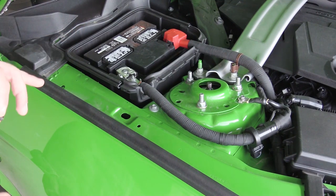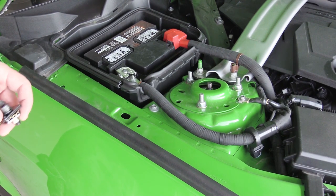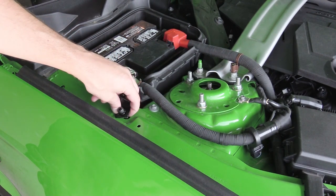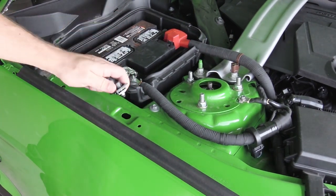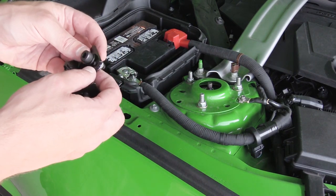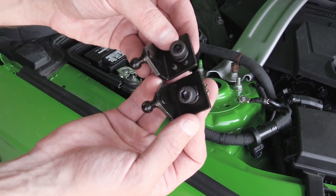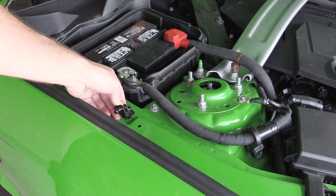The instructions say this next part is the trickiest part about this hood strut installation. Next thing we're going to do is get this up inside there — what you're going to have to do is put it in even with it and then kind of turn it while it's in there so that this goes back and forth, and when you pull up it's not going to come out because this is underneath. One thing to note: there are two little circular indicators on one of the struts, and on the other there are not. The one with the circular indicators is going to go on the left side.